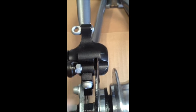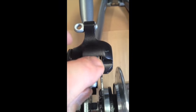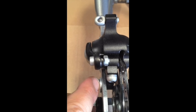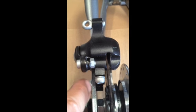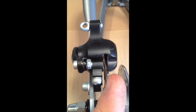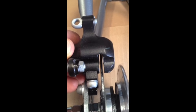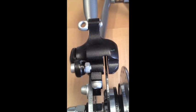If you cannot move the caliper far enough to get the rotor away from it, there are two extra washers on the outside of the screw. You can take a washer and put it on the inside of the dropout to move the entire bracket system toward the middle of the wheel. With those procedures, you can usually find a good way to get the rotor right in the center of the disc brake caliper gap.